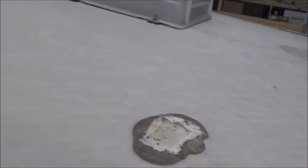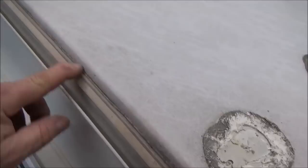So, this is just Dicor junk. We don't believe in it. Dicor is a ripoff. Don't buy it. So, we'll check the rest of this out. But what's on our work order is just doing the back wall. This would have to just get cleaned out. Now, if you have something like this, you take a knife to it, you risk cutting the roofing. You want to use something plastic, like a plastic knife of some sort, just nice and easy, and go and clean that out.